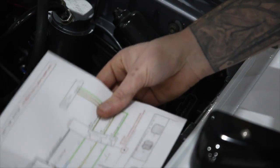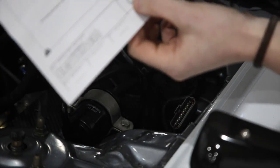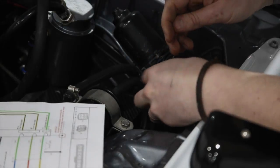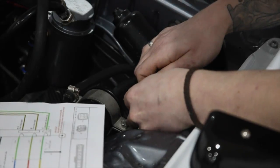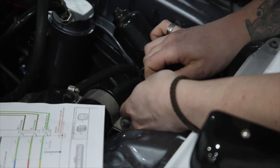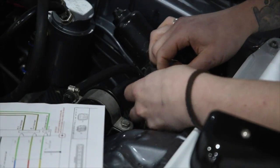Now what I've got here is a simplified version of the wiring diagram. And let's pick our first one. So leading trigger is solid green. And it's got the code LG, and you can see from one side, that's the 3rd one in. So if we have a look in here, we know there's a blank at that end, so we know which end to start, which is here. We've got green and black, and then we've got our solid green. So that's one we need to de-pin.